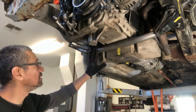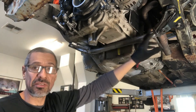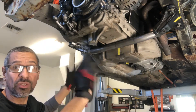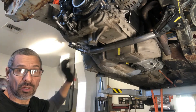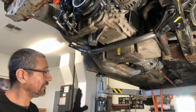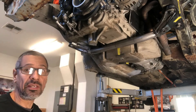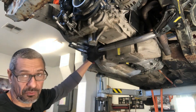Got it tack welded and in a good position. In the areas I was able to weld well, I went ahead and got that done to minimize the crossmember twisting from heat. Once done, I took it down, welded all the way around it, threw it back up, bolted it on, and she went on smoothly. I then grabbed my air gun and cooled the whole piping and brackets down to minimize any twisting from the heat.